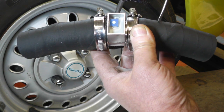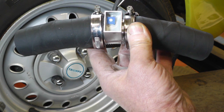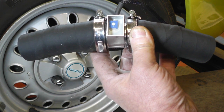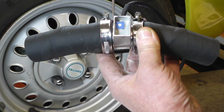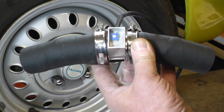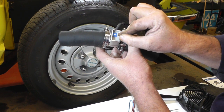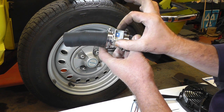We've got the control unit fitted in the hose now. If you can see the little adjuster screw in the centre in that blue square — that's the adjuster you can turn to alter the temperature at which the fan cuts in and out. Just adjust it by trial and error to find the range you want. I've left it loose on the hose for now so we can get everything fitted and turn this round to get it at the right angle so we can get a screwdriver in easily before we put the dust cover on.